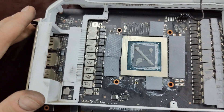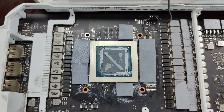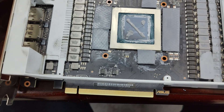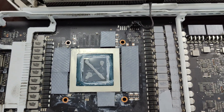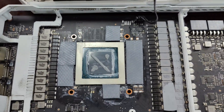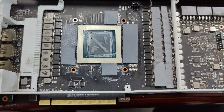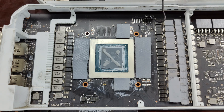What should you expect from changing out thermal pads? For Gigabyte we saw a 10-degree drop, and for Zotac a 15 to 20 degree drop. It's going to be interesting to see what the drop will be on this card, but given that we're putting on high-quality thermal pads and paste, I'm assuming it'll be in the same range — probably 10 to 20 degrees. If you're in a hot environment, make sure you do replace them. If you're in a cold environment and staying under 90 to 95 degrees, maybe you don't need to. Like, subscribe, hit the bell, and more thermal pad replacement videos are coming. Until next time — bye.